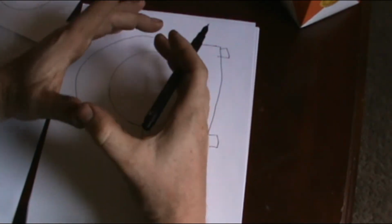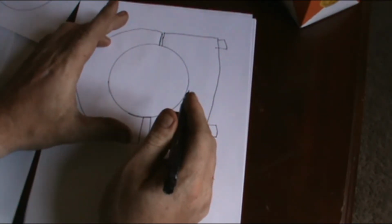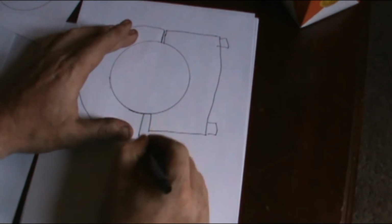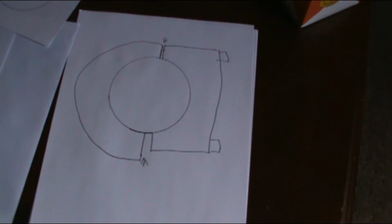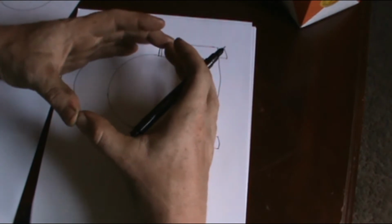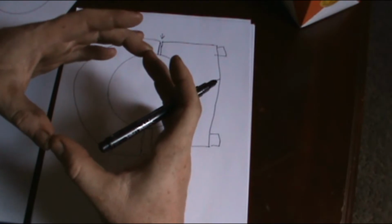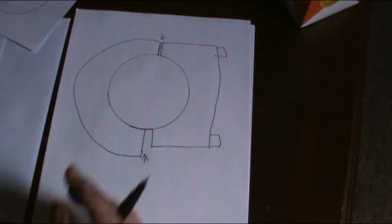The only way that you can physically clamp something or hold it in place when it's round is one of two ways. Either number one, you make it perfectly in line with the cap, or two, you give it a little bit of a gap. Now, it won't be much of a gap. I honestly don't think you're going to see one over maybe a half a thousandth, but there will be a gap, and that gap is meant so that the bearing cap can cinch down, but not overly deflect the bearing housing, because if you do it too much, the bearing will go like this, and then it doesn't go around. So you want it to compress it but not deform it.